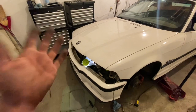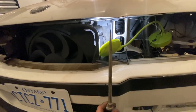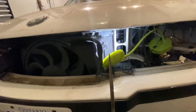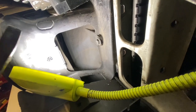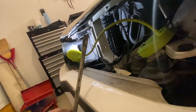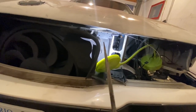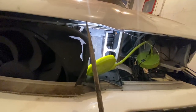The hood is closed. Let's go underneath and open it. So when you're sliding the screwdriver in through that hole, you don't want to put it in this way — you want to put it in this way. You're going to put it in that hole and also tilt it at an angle towards that back part to go in. So it's going to go in like this, and if you're looking at it forwards, it's going to be kind of like this. Once you have it in there, all you have to do is twist it, and the hood should open.